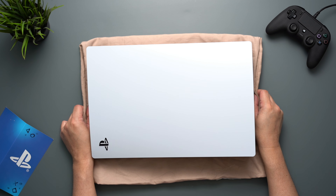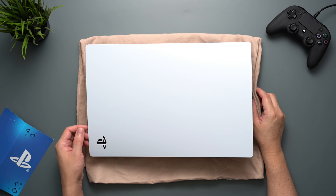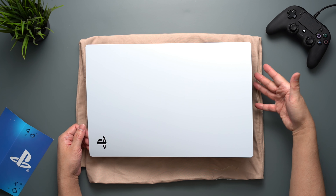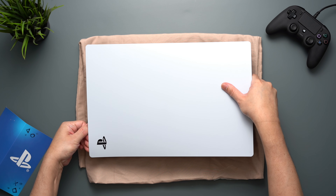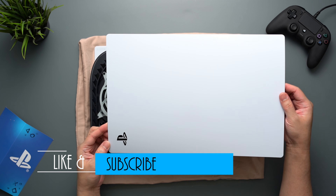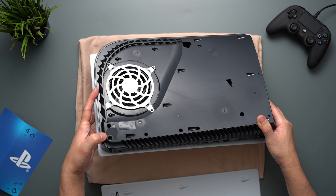Removing the plate is as simple as this: lying down your PS5 with the logo near to your left hand, then lifting it up a little bit while pressing the bottom part of your PS5, while your right hand is pulling to your right, with the rest of your right hand fingers pushing the base of the PS5. The reason why we need to lift the corner with the logo is that there are two protruding circles which are the ones that make it lock.